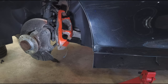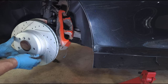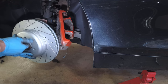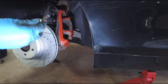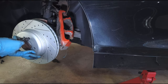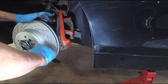These rotors weigh a metric ton. I've got one of the lug bolts in my hand and I'm lining up the rotor screw hole with the top. It's easier to get a lug on there first if you're doing this by yourself, just to hold it in place because it weighs so much. This is the rotor screw to hold it — I put a little bit of anti-seize on the end because you want it to come off next time. Remember the rotors are marked left and right: driver's side is left, passenger's side is right.